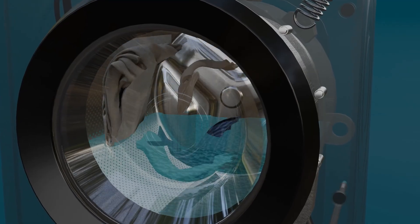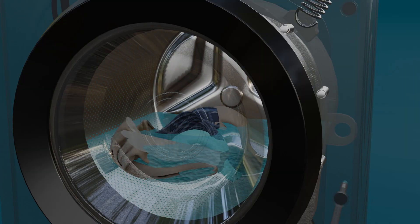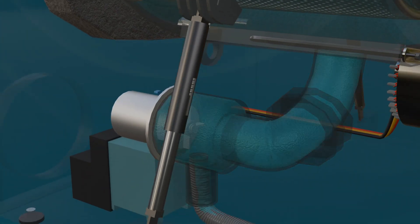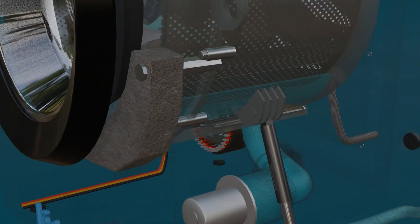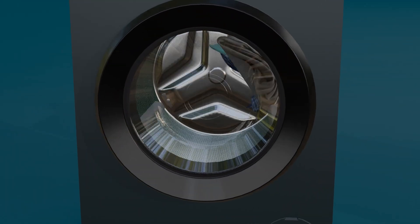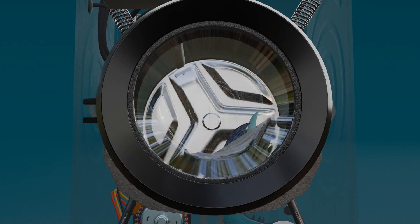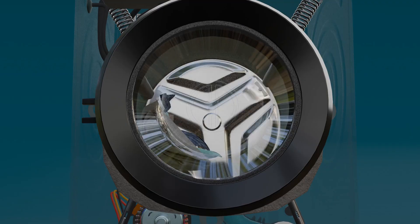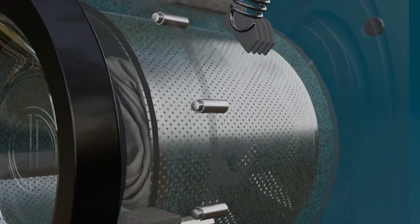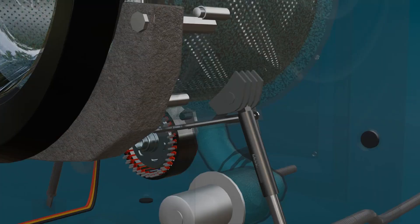One important note: you can't open the door immediately after washing. The machine stays automatically locked, since opening it would cause water to spill out. To manage this, a drainage pump connected to the outer drum through a pipe removes all the dirty water from the machine. Once the water has been fully drained, the drying process begins. The inner drum spins at high speed, often reaching up to 1200 revolutions per minute. At such speeds, centrifugal force pushes the clothes tightly against the inner walls of the drum. Tiny holes in the drum allow water to escape into the outer drum, where it is then pumped out through the drainage system, and the clothes begin to dry through the rapid spinning motion.